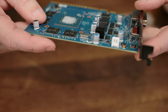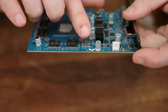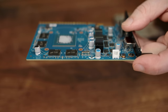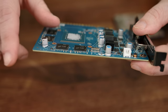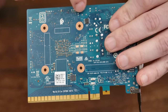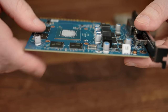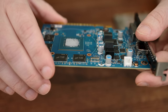So the heat sink is going pretty well, but unfortunately I ran into one problem with the graphics card and the layout of it, and that is this little guy right here. This is a crystal oscillator, and it lays directly underneath the heat pipe, so I'm not going to be able to shave back the heat sink in order to fit around that. Remember at the beginning of the video when I said don't try this at home? This goes doubly for this part. I'm going to unsolder the crystal oscillator and flip it to the back of the PCB. It should still run just fine as it is a full pass-through component and give me the little bit of extra space that I need to get the heatsink to mount up to the die. So, let's give that a shot.